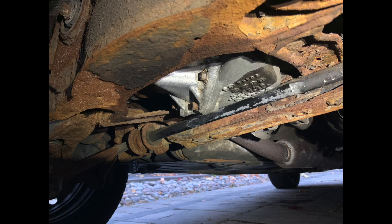That's all we're going to change for now, but the fact that the entire diff was covered in fluid may mean it takes longer for all of the leaks to show themselves. Being that it's winter and I don't want to trash this diff — I have seen S40 T5 all-wheel drive and V50 T5 all-wheel drive and other Volvos with trashed rear diffs, and those cars are all being parted out online — taking care of any component of these all-wheel drive systems is very crucial to not turn these Volvos into normal front-wheel drives.